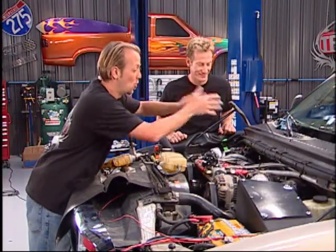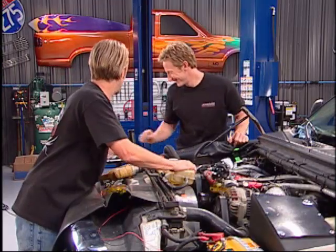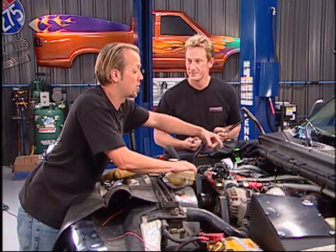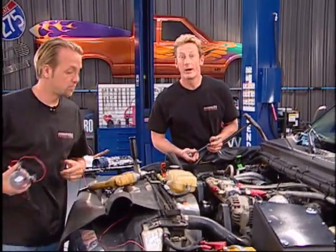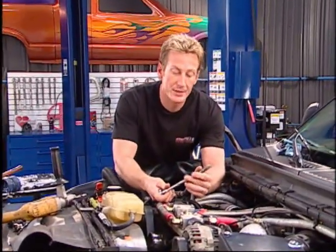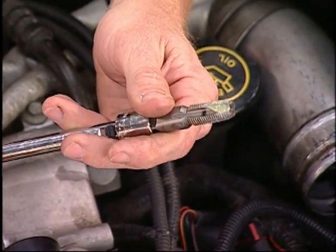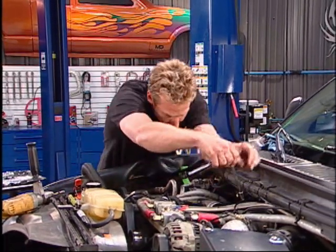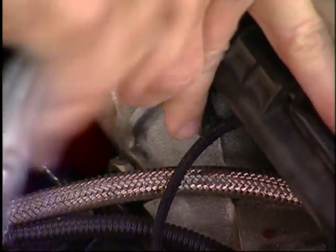Welcome back to Truck U. We've got the hole drilled ready right there on the intake. We couldn't find our aluminum magnet, so what we did was use a vacuum right there sucking everything out. We also had a rag tucked down in there too — you want to be really careful and not get any metal shavings down in there. Now I've got to go ahead and tap that hole Matt just drilled out. Before you tap through this, always put a little lubricant — I've got a little grease on here. The reason why is it'll keep some of those aluminum shavings on the actual cutter versus going into your intake. I've still got the rag placed in there, and then once again you want to hit it with the vacuum so no shavings go down into the engine.